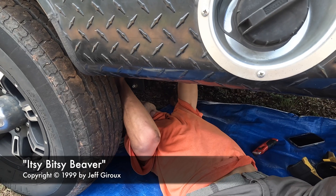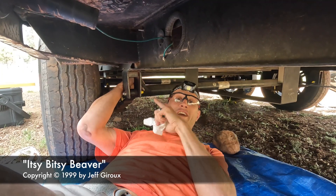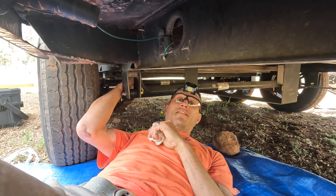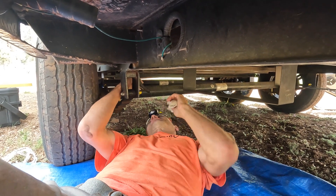We're probably down to zero brake shoes. But I think I found the source of the problem — it was probably a faulty breakaway system, probably like a $15 part. Inspect your parts, guys, because now I've got to replace hubs and wheel assemblies. What a mess. The breakaway cable fried these cables going to the brakes and I'm trying to salvage what I have. What a disaster.